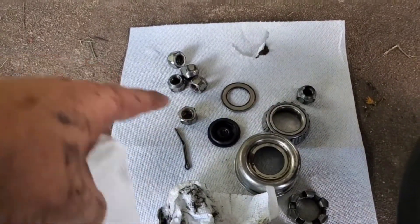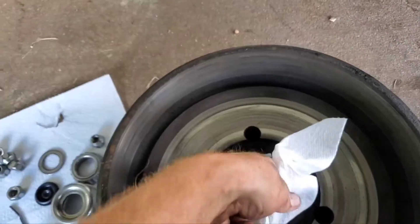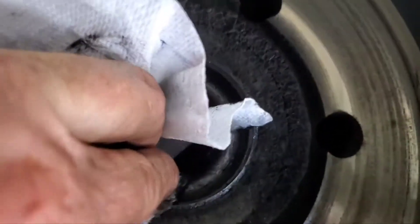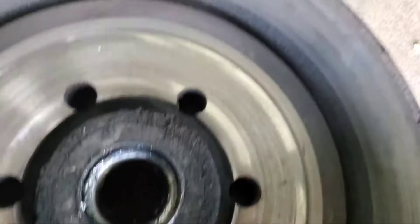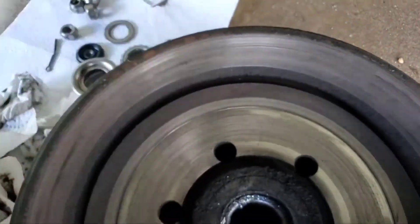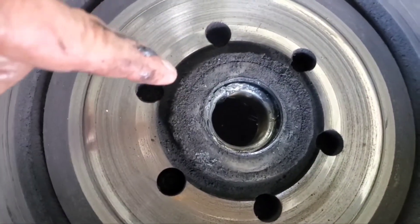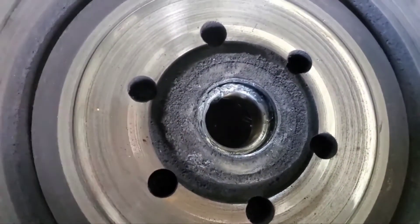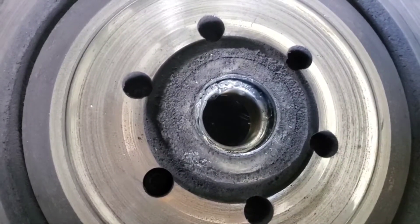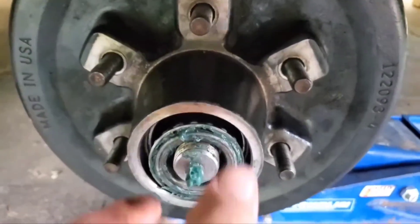You want to clean everything — don't forget to get the grease and the bearing out of your hub. There's a bearing right here; you need to get all that cleaned out. Side note: different greases may not mix together very well, so if you mix two greases that don't agree with each other, you'll have no grease at all. I've got the hub on and packed my bearing full of grease.